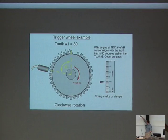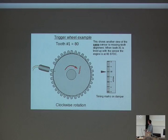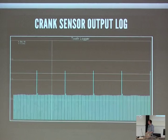Once you set the engine to top dead centre, you'll be pointing at a certain tooth. If you rotate the engine so that the first tooth after the gap is pointing at the sensor, you take a reading for what angle you're at and can know where the engine is after that. Logging a sensor like that gives you a pulse train — the y-axis is a measurement of how long it took between each tooth in milliseconds. For a 36-minus-one wheel, the pulses are about 0.7 of a millisecond. The long ones are approximately twice the height of regular ones, so you know you've missed a tooth.